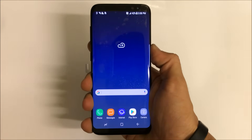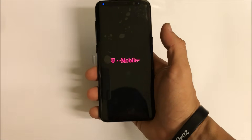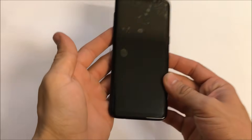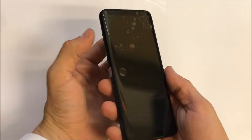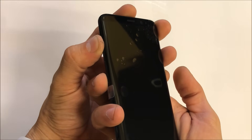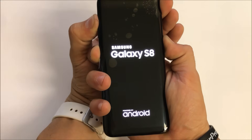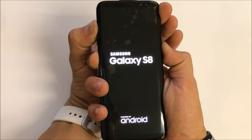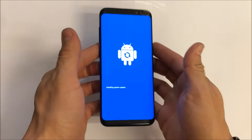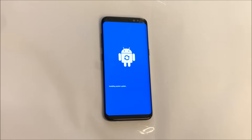I'm not gonna do it that way, but you can if you want. I'm gonna power off the phone now and show you the hard reset method. Once your phone is completely off, you're going to hold the Volume Up button, the Bixby button on the side, and the Power button — all three at the same time — until an Android appears. Once it does, let go, and it's gonna take us to the Android recovery menu.